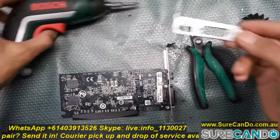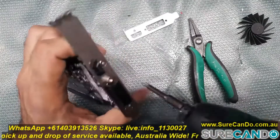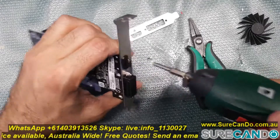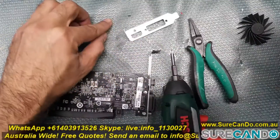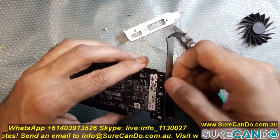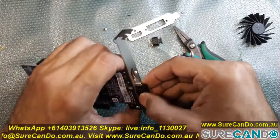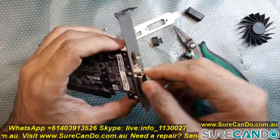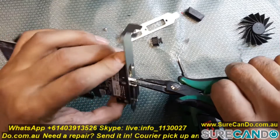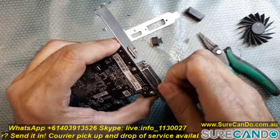You'll need to remove one screw holding the plate. Depending on your card, sometimes you have a DVI like mine, or a VGA, and there is a rivet connector in place. You'll need to use pliers to loosen it and then just unscrew it and it will come out of its position. Then the plate shall come out easily. Reverse the process to install your low profile bracket.